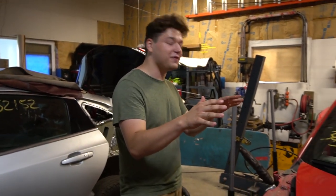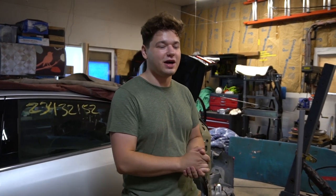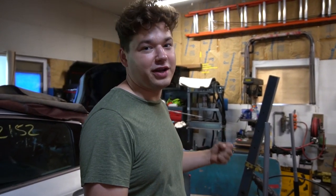Welcome back to Saddle Soul Garage. If you guys haven't seen already in the previous video, we took off the fender and the door to view the damage a little bit more. We've seen that there's actually quite a lot of it, and there's some hidden damage in the floor compartment. In this video, we're going to prep the vehicle completely for framework, chain it down to the ground, and start pulling the frame.